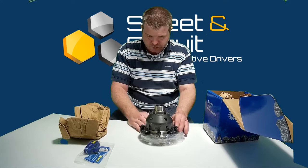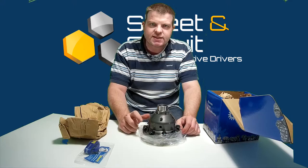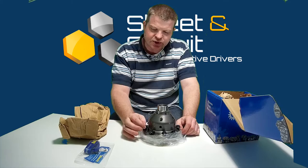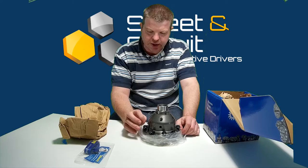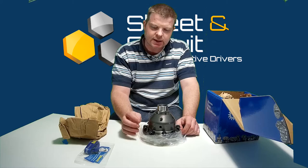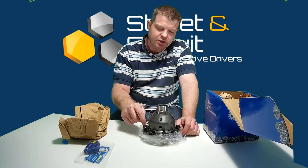This is what the differential looks like — pretty standard design, really. This is what you'll see on most differentials; the casings are all very similar. The difference with this diff is that it's supplied with bolts. To the best of my knowledge, they're supplied with this diff only, because there isn't a ready bolt kit on the market. Usually we supply ARP fasteners if the customer needs it, but for the 02S gearbox, ARP don't actually make a diff bolt kit. The price includes the bolts — basically everything you need to fit it.